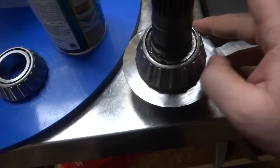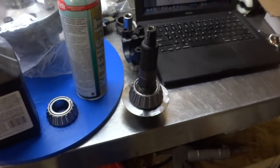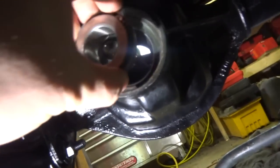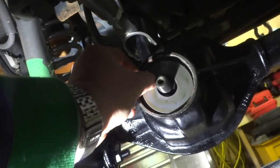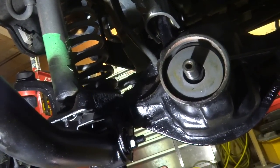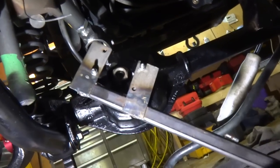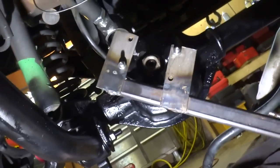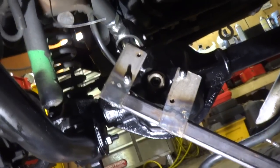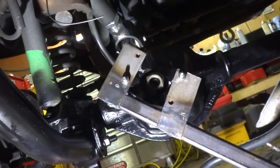Let's just get this inside. I just finished putting some light oil on my dummy bearings here, so now we're going to insert this in the differential. I'll put the bearing on and the oil slinger. We're not going to put the sealant until after it's set up. I got my yoke on and I made this little device so I'm tightening it up — I don't have to bother trying to hold that yoke. I'm going to grab the impact gun now, take all the wobble out of it, and then tighten it by hand until I get the desired torque.